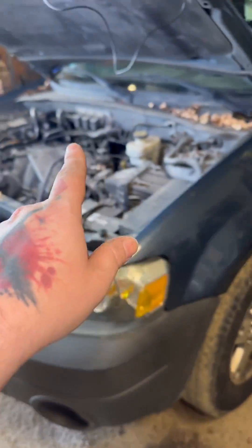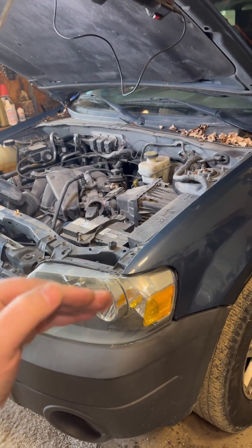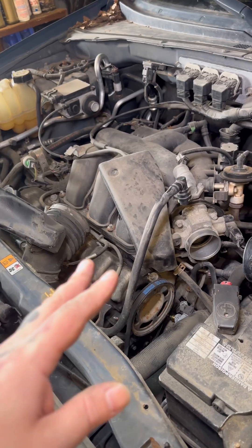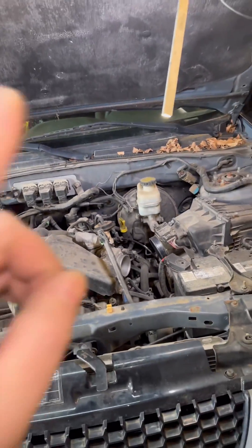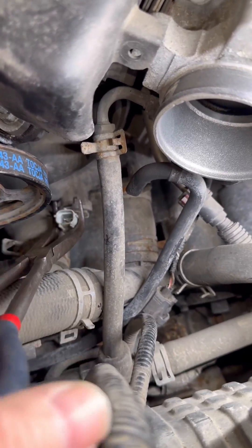That's why it's important to have live data — the sensor was bad but still within range, so it wasn't throwing an engine code. There's nothing to point you in the right direction without live data. You have to go through it and see what looks off — with the engine warm, cold, running, or sitting — that's diagnosis. We could have jumped to looking for massive vacuum leaks, but based on the customer's story that wouldn't be right. Could be fuel pressure or a fuel pressure regulator, but the first thing you do is bust out a decent scan tool, check for codes, check live data, look for anything that's going to cause the no-start.